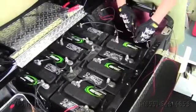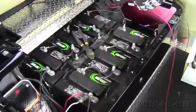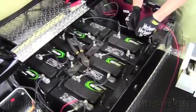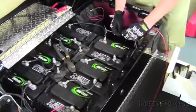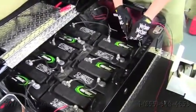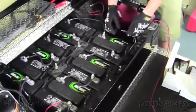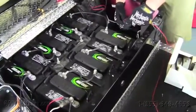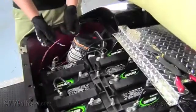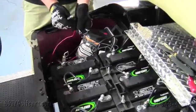We'll put the wire through and grab some wire crimpers to crimp the wires, then run the negative and the positive and do the same. You can probably wrap some electrical tape around there just to hold them in place, give it some extra security, and to keep them from touching.